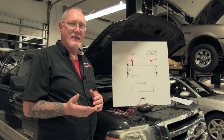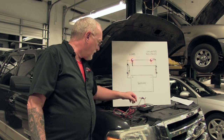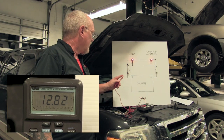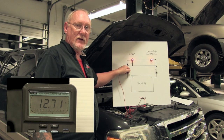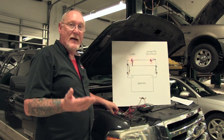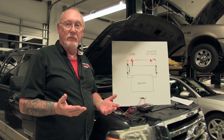When I first started learning voltage drop testing, I was taught to take three measurements. The first was to measure the voltage at the battery — make a note of that. The next measurement was to take a measurement as close to the load as you could get on the positive side of the circuit — record that. But then you had to do a little math; you had to subtract the two from one another, and that would be the voltage drop in the system.